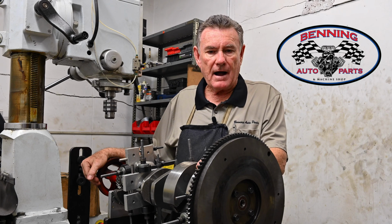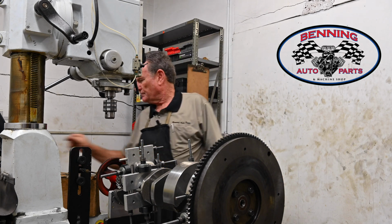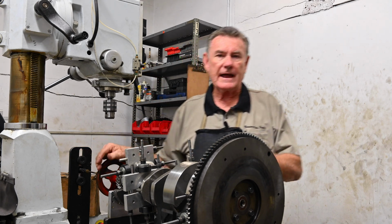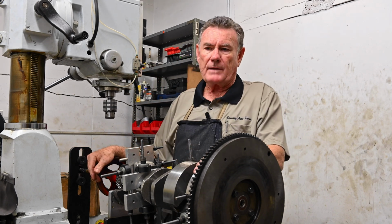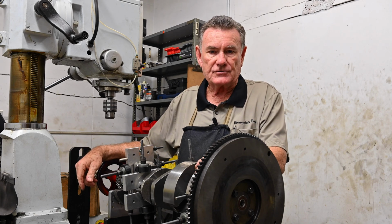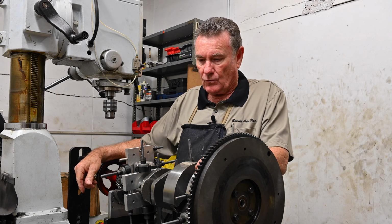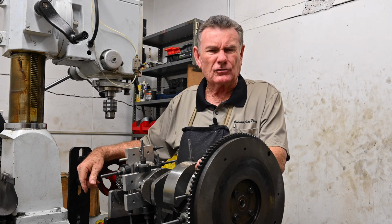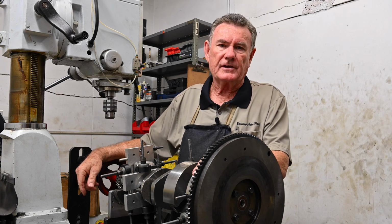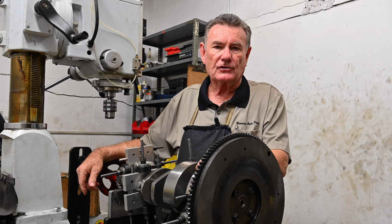Like I said earlier, this is a Scat 4-inch stroke crankshaft with H-beam rods. The bob weight on this, actually I'm wrong, the bob weight on this is 1,492 grams, which is a pretty light bob weight, but that's because the bore is only 3.312 inches. 4-inch stroke, 3.312 bore. So the stock crank, I believe, on a 239 is 3 3/4. So we're going to a 4-inch stroke, which is a 1/4-inch stroke increase, which gives us the additional cubic inches that the customer is looking for.